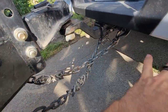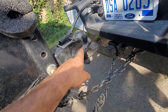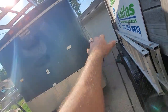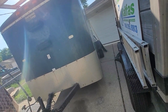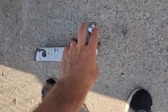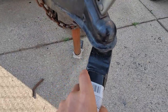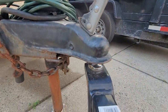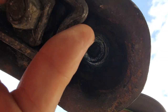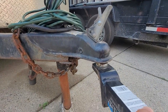This is the heavy-duty hitch with a truck mount. It has a two and five-sixteenth inch ball, so the cup is bigger than your standard two-inch over here, which is a light-duty one, 3,500-pound axle box trailer. It's a 14-foot since it only has one axle, not a ton of weight — your basic two-inch ball. The housing right here with this hitch fits perfect, right up in there. You can see up inside of there — this closes over and around the bottom half of the ball to secure it. It locks it in place.